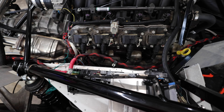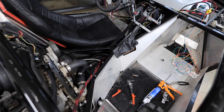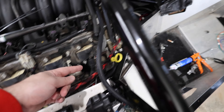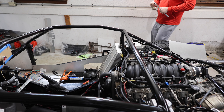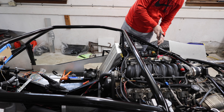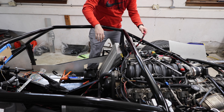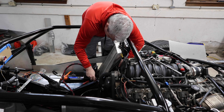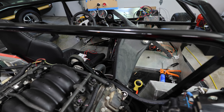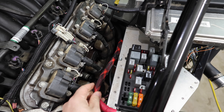While I'm doing that wiring, the next thing I need to sort out is essentially the battery cable. I ran the battery cable through here while we were trying to get it running but it really needs to run down underneath into the front. So I'm going to take this apart and fish it back through underneath, tighten everything back up. We've got the wire routed down through the front side of the chassis back up here away from the exhaust.